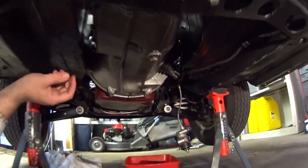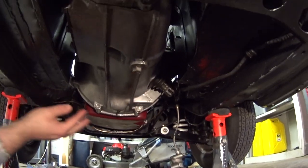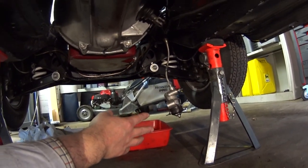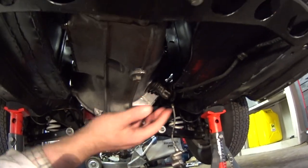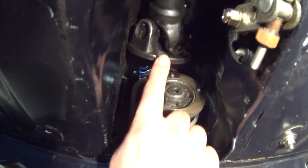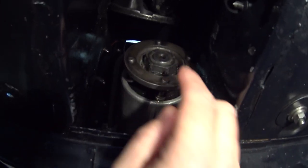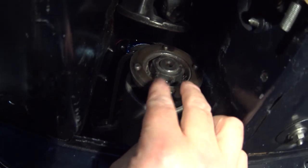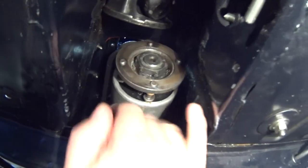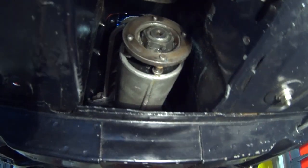You'll be able to see that I've disconnected most of the bits from the gearbox already because we're halfway through an engine and transmission change. The clutch slave is just dangling there, that's been removed. We've also taken the exhaust off to give ourselves slightly better access, and at the back you'll be able to see that the prop shaft has been removed too. I've also put a little elastic band around these four bolts that secure the prop shaft to the gearbox - it just stops these moving forward, because when I drop the assembly they will catch on this crossmember when we try and remove the gearbox.